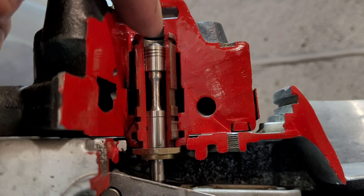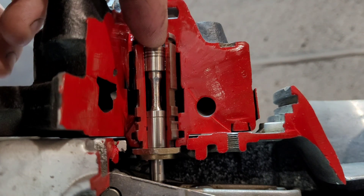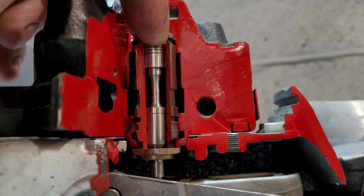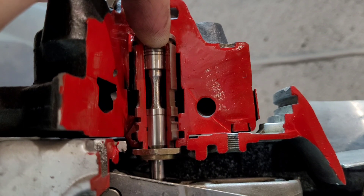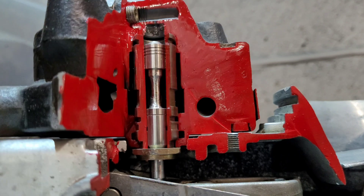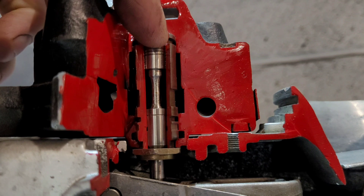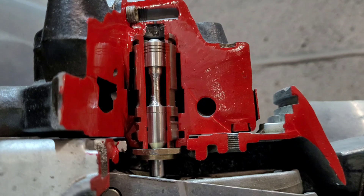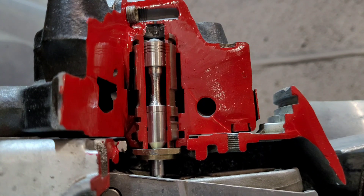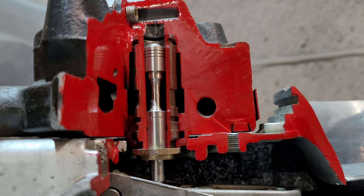What we have is an acting force in this chamber. With the pin down, fuel pressure comes in the top end pushing on that pin. The greater the force on top of this pin, the harder it is for the air flap to move up — it will move up, but you've got a greater force pushing down, which limits the amount of fuel that can come out of the slots. If we reduce this pressure, then at a given time when the air flap raises, it's easier for the fuel pin to raise up, and as it raises up it lets more fuel out.